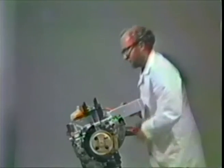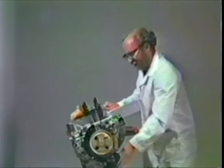But when you rotate the engine, make sure that the pistons and cylinders don't slide out far enough to uncover some of the rings. You would have to then use the ring compressor to put them back on again. Rotate the engine a bit to where no pistons are at top dead center. Put the engine in almost a vertical position here. And now we'll show you how to put the heads on.